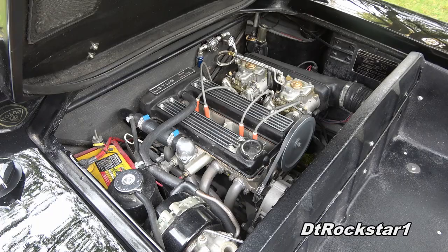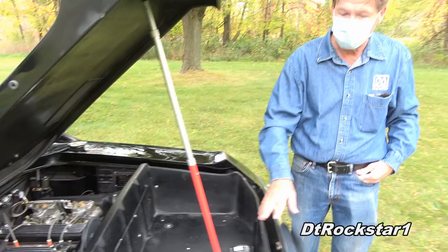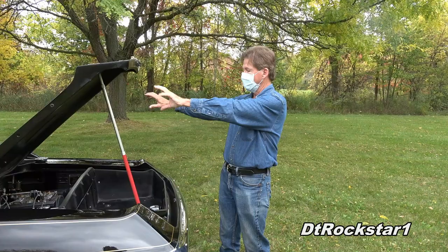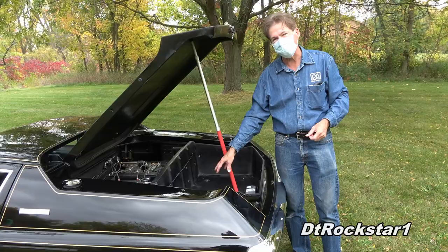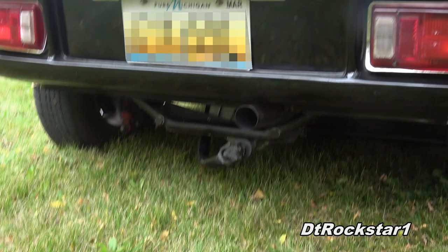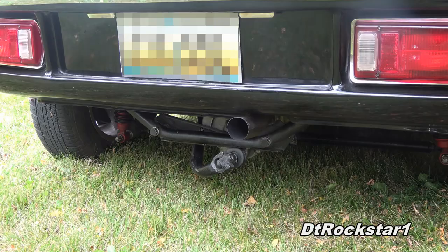The car you're looking at is, the body is all fiberglass. The chassis is a backbone type chassis. It's got a T at the front to hold the front suspension. And then there's a backbone, and there's a Y at the back, which cradles the engine and the transaxle. As a matter of fact, if you come look at the back, if you get down low, you can see the transaxle, which you're looking at down there. That's the shifter mechanism coming out the back of the transaxle. You have a cross brace and the exhaust pipe. As you can see, the car is pretty low.